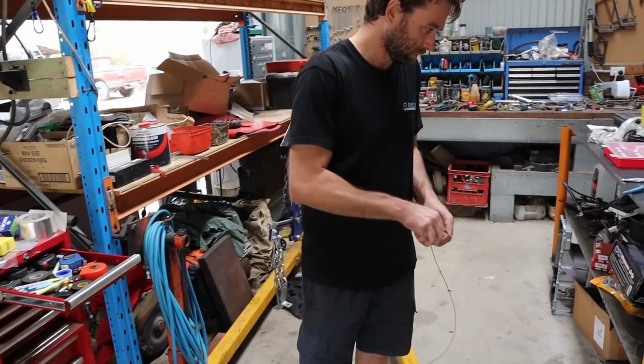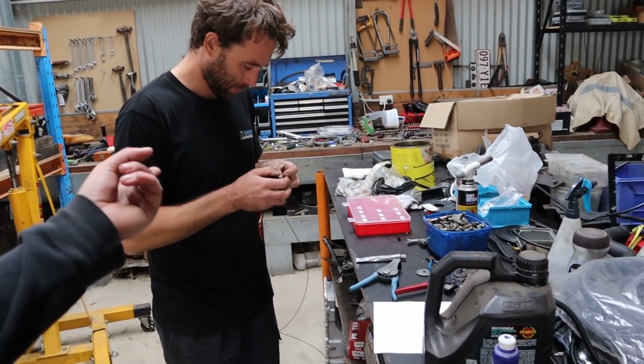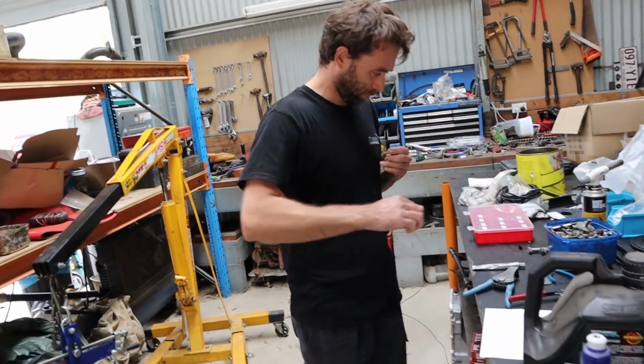Right, so we're currently making a flying lead. We've pulled the MAP sensor pin out of the PCM because we obviously do not need it anymore, and we're using that to make a flying lead for a new sensor wire with an ECU pin on it for the PCM, which is going to be helpful in doing a bit more fault finding. We've got some spare US car injector plugs, so we're gonna make our own injector plug, which will have its own shorting clip to its own independent 12 volt and that flying lead to the PCM. That way we can start pinning injectors with a whole new set of wiring again, in the hopes that we can find something.